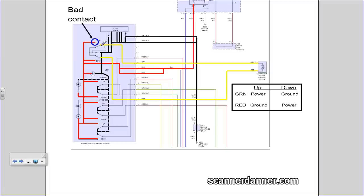So where is my problem? Bad contact. On the up version, the green wire is not getting power in the up position — you have a bad contact right there. We need to make sure our main power and ground are good, but keep in mind the down position works, and the main power is shared between down and up, as are the grounds. If it works in the down position, it has to work in the up position. No external powers and grounds to check. Bad contact — that's enough right there to make the call.